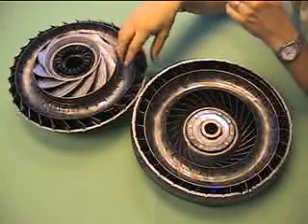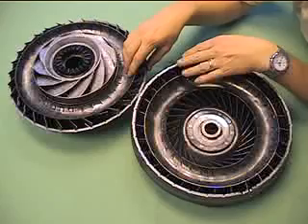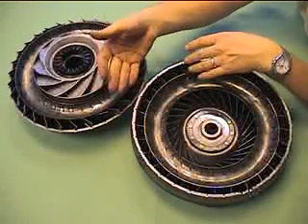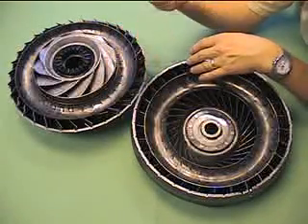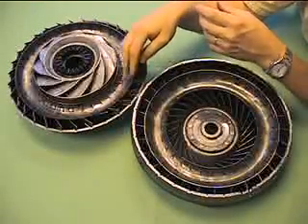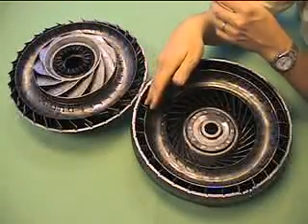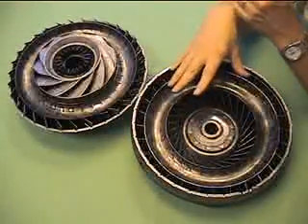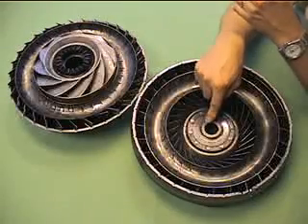When this thing is running, the entire casing is spinning and it acts like a centrifugal pump, essentially slinging fluid through these vanes and giving them momentum from that fluid being slung outward. It comes out of these vanes and hits into the vanes in the turbine, causing it to start spinning and sending its motion through to the transmission through this spline.